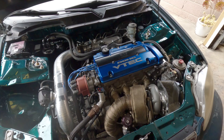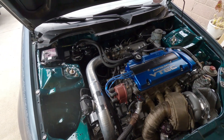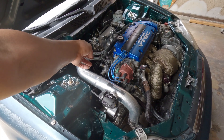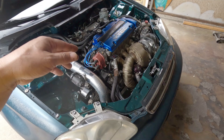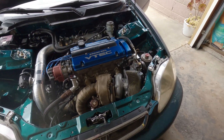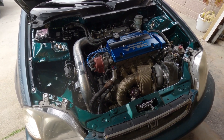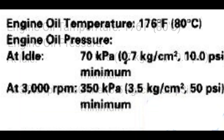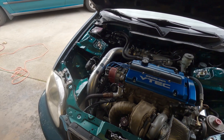I'm going to wait till the engine cools down a bit, and I still have to make a bracket where I can mount the sensor underneath. I'm going to use that area and do it again — at least we'll see how much oil pressure there is at idle. I think the minimum is 10 PSI, but I'm not sure. I'm going to check it again and we'll do it again tomorrow. I'll see you guys back.